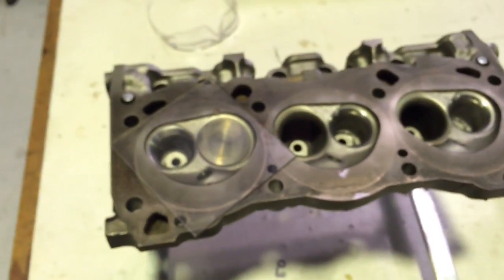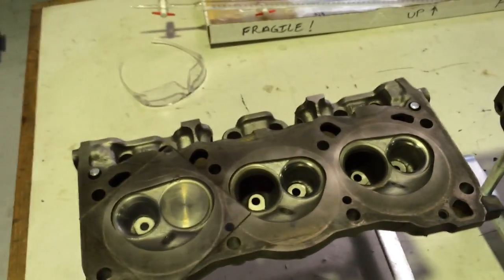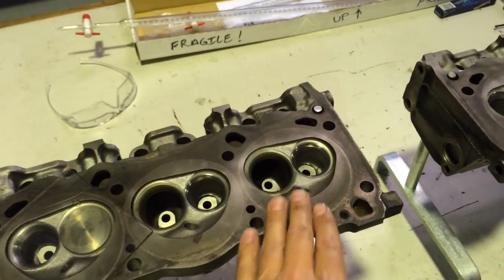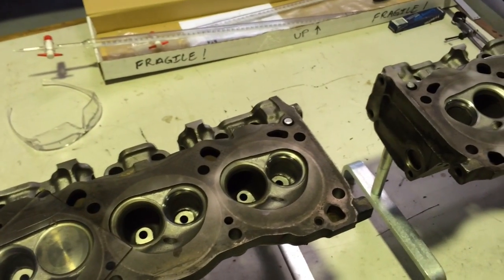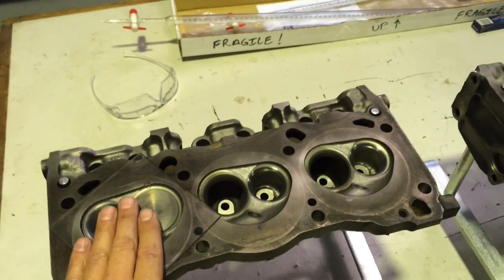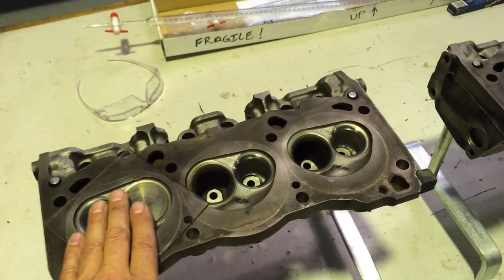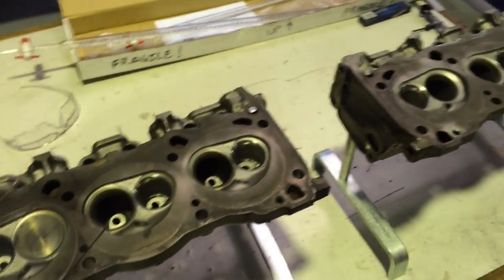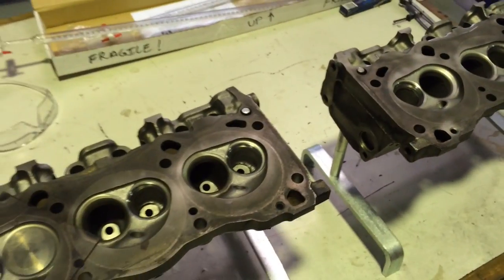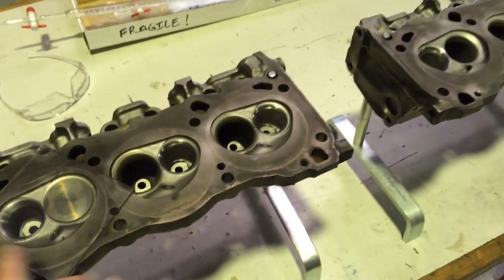That's why there's a difference in price in cylinder heads. When you're getting close to your compression ratio rule of 9.5, we need to check every chamber in the off chance you've got a smaller chamber or a different volume and one of your chambers is going to go over 9.5 to one. If you're down around nine — if we calculate that you've got around 9 to 1 compression and you're happy with that — then generally we don't have to spend as much time checking every chamber. We'll check one chamber from each head generally, to keep the costs a bit lower. But if you're getting up close to 9.3 or more, we will do every chamber.